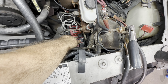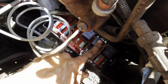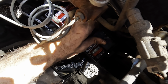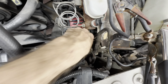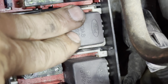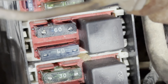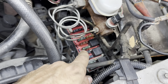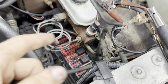The fuel pump relay right here was buzzing. I can't say I've heard a fuse box making a pumping noise before. I can feel it — it's this relay right here. If I pop it out, the noise stops. And when it's back in, the buzz is back. That buzzing is the coil in this relay going open circuit, close circuit, open circuit, close circuit. That relay is not making good connection.